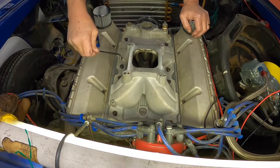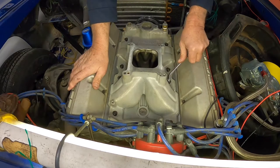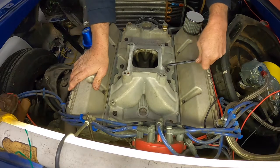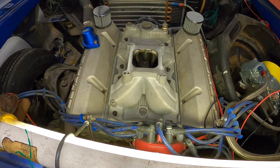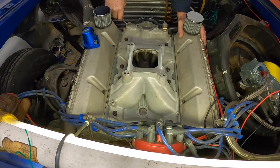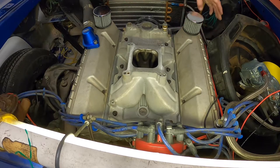I don't know if anybody's ever really experienced an actual gasket runner leak on one of the runners, because of uneven... I don't know. Well, even if you did, how would you tell? I mean, you're going to have vacuum at a port runner. It would lean a motor out or suck oil into it, from the valley. But between the two runners, you probably wouldn't even notice that, would you? Not really, especially on this engine where you've got just a single plane and your runners actually run together.